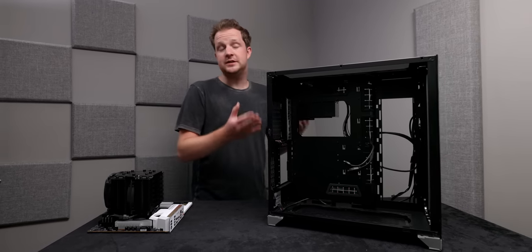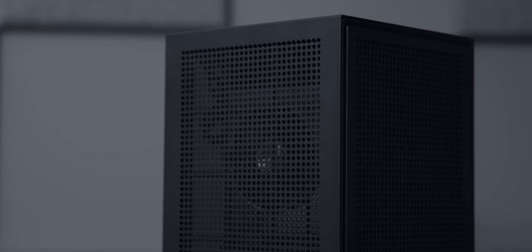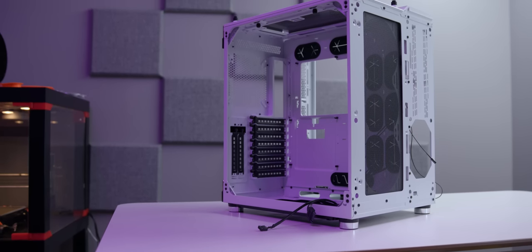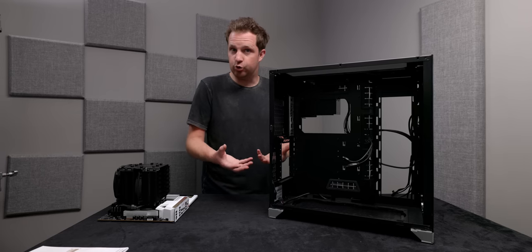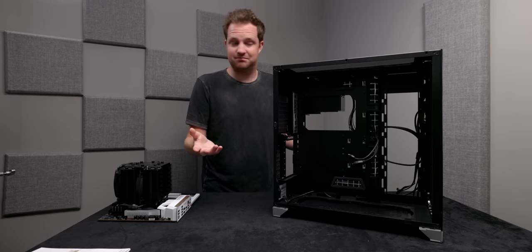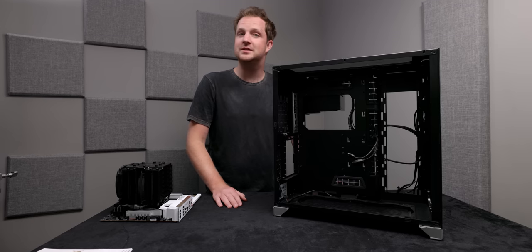On the other hand, where the PC market seems to be moving — and I think it's a better option — is to really well-ventilated mesh cases. Newer cases have completely mesh front and back panels with nice light side panels, creating a great environment for airflow. If your components stay cool, it doesn't really matter that your fans are spinning because they don't need to spin very fast, and if they don't spin fast, they don't make much noise.